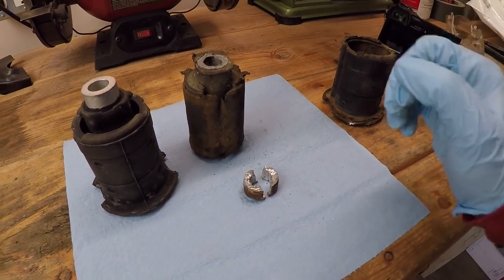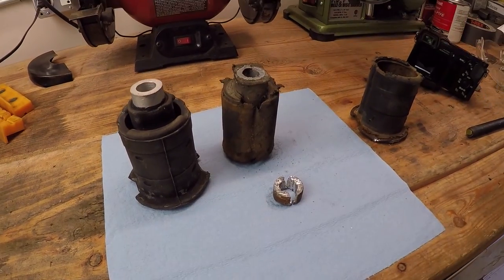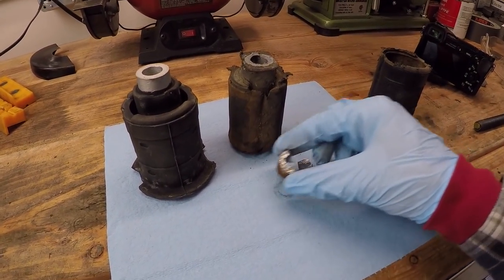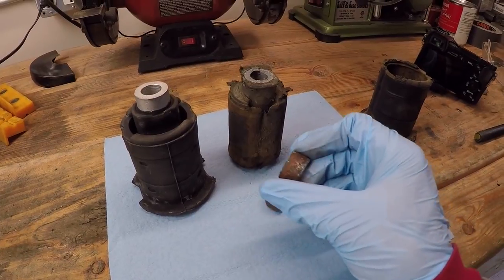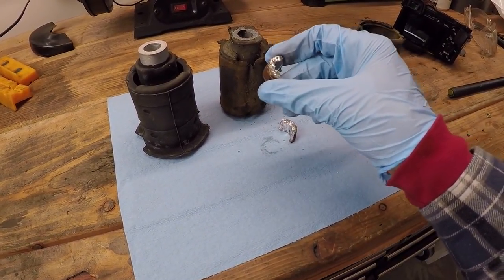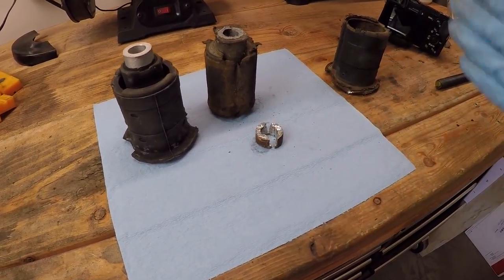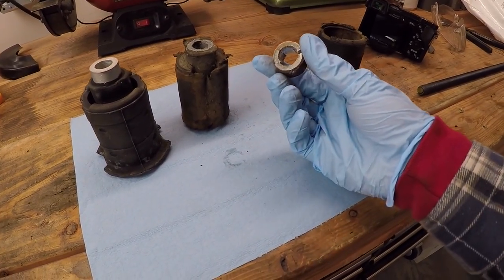And then I used a small tip flat blade screwdriver and just kind of got into the edges here and hit it with a hammer and used it as a wedge to free both sides of this out. So as you can see, there was a lot of rust and corrosion on those, but with a little bit of hitting with the hammer, I was able to free them up. So again, I think it's a tungsten carbide Dremel bit. Be sure you have that on hand